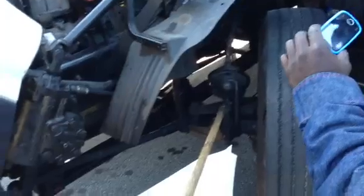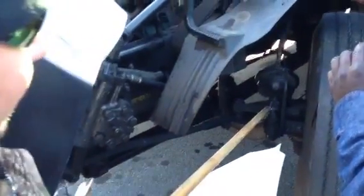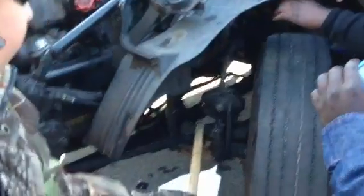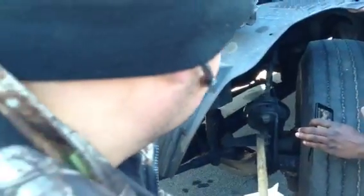Okay? Then I'm going to come over here. I'm going to check my push rod. This is my push rod right here. I want to make sure it's properly mounted and secured. It's not bent, broken, it's not cracked. There's no illegal welds on it. I also want to check that my push rod and my slack adjuster, my pins in there, connecting them two together.